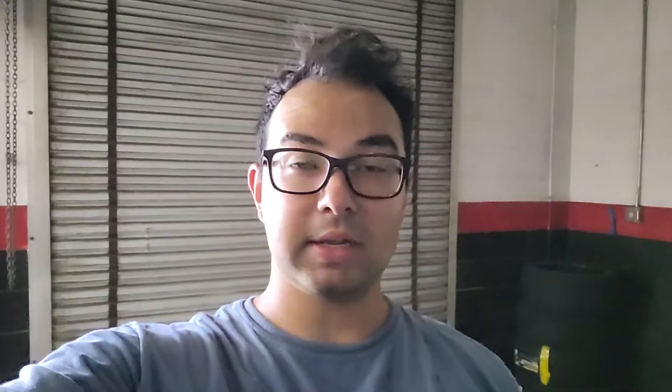Quick update on what's going on with the FC: I'm actually going to be detuning the car, putting less power than before. Before it made almost 500 horsepower — I'm bringing it down to about 350 to 360. The reason is longevity of the motor and safety. I'll be on high revs and don't want to stress the motor, especially right now in LA where it's really hot, and Willow Springs is going to be about 100 degrees. I want the motor to have a longer lifespan and more seat time. We're going to have DK tune the car to about 360, running off the wastegate spring at around 10 pounds — before I was running 14 or 15 with the boost controller.